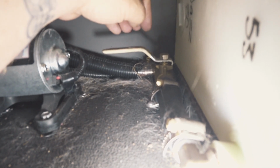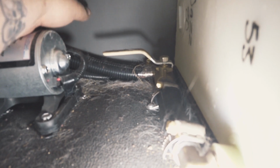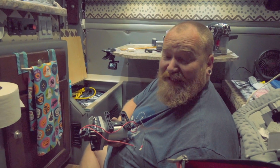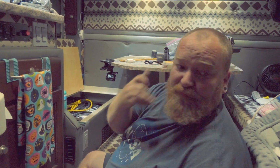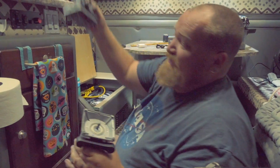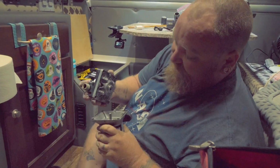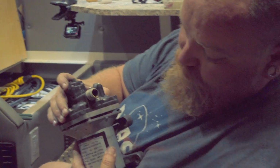But instead of emptying your tank, just shut this water line off so there's no water going to the pump. All right, we got the old pump out. Where is it? It came out in 2 pieces. There's part of it there. So what happened was the mounting screws for it. Make sure I got this back the right way.